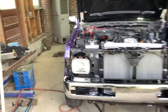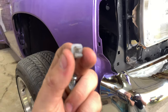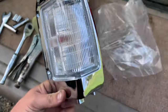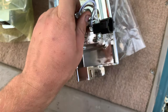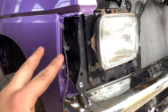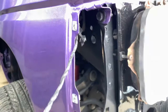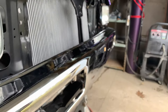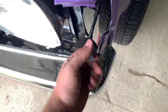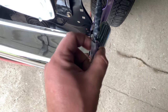That is beautiful. Now the next thing is to put these corner lights in. To put these in I'm going to need these little rubber pieces — basically they go inside the fender and allow the screw to have something to grab onto so you can mount your corner lights. I got our new corner lenses — I always love the way these look. Also, I always swap out the orange bulb for a regular halogen; it still flashes kind of orange but you don't see the orange through the clear. I also forgot to mention — I swapped the blinker wiring from down here up here. I tried swapping the clip over but I don't think this side is getting power, so I'm going to wire test this and figure out where a line may have gotten cut.